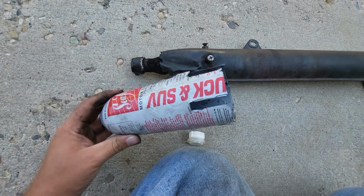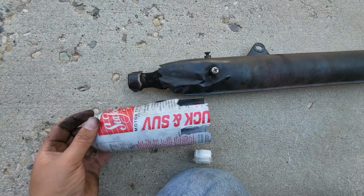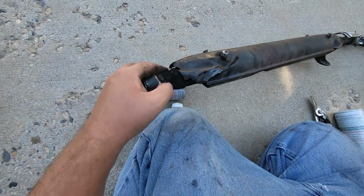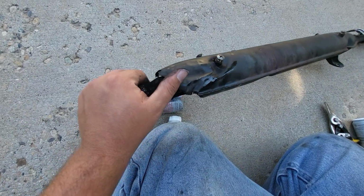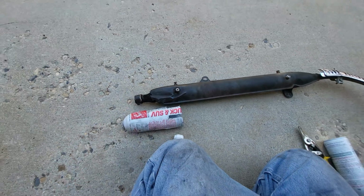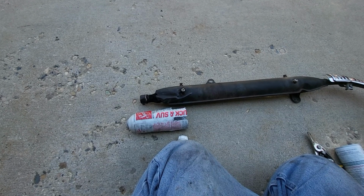So anyway, basically from this point, I'm going to slip it on there, and you want to take a hammer and it'll just tap right on with a hammer. And a way of getting it on there better is you just kind of bend inward all the extra metal here that is broken off or bad. We're just going to be tapping this on here, drilling a few holes here and there, pop riveting it on there, and putting some epoxy and probably even painting it.